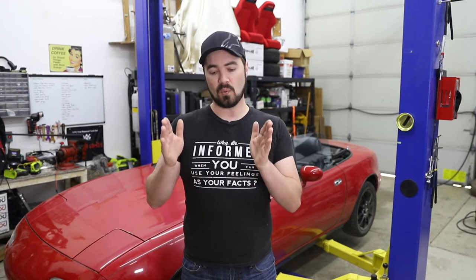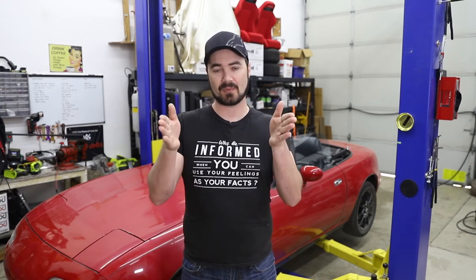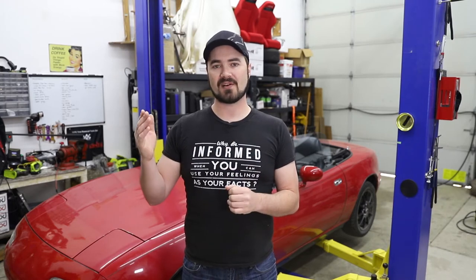In this case, we took the catalytic converter out and put in what you would call a test pipe. It's essentially something with the same flanges as the catalytic converter, but it's just a straight through piece of pipe. Now, once we put this new exhaust on, it fixed a lot of the rattles and things that were wrong with the rusty exhaust system, but we now have a high-end rasp that's really annoying, and that's because the catalytic converter is missing.